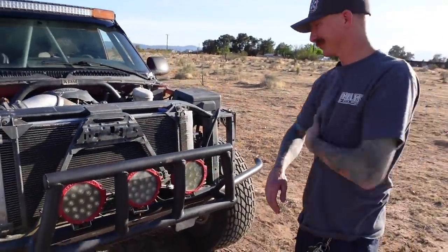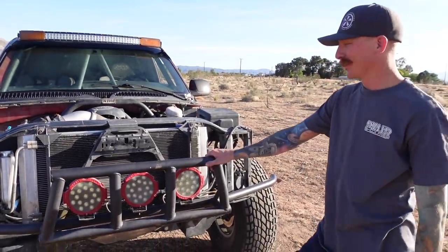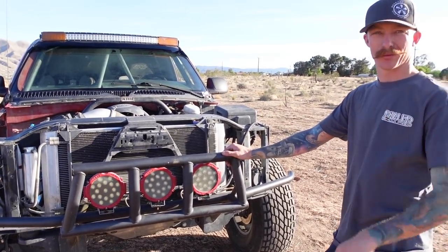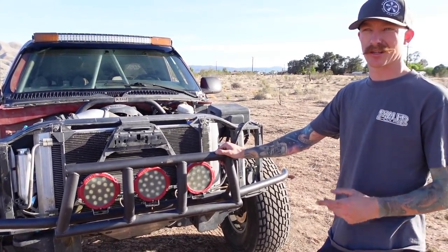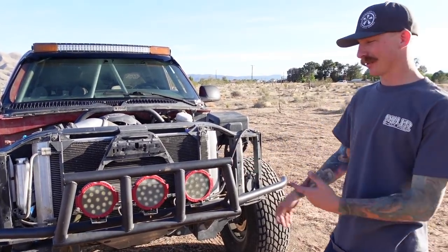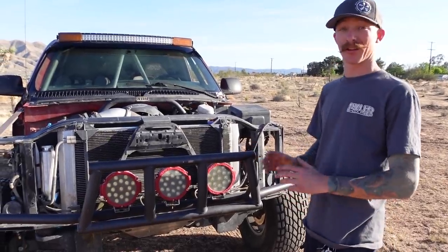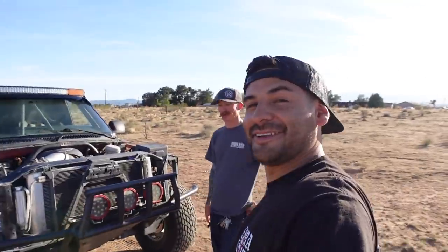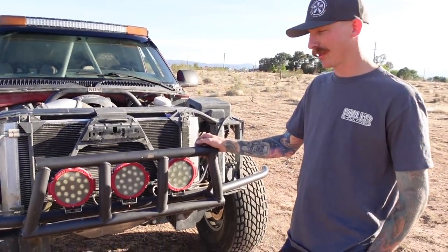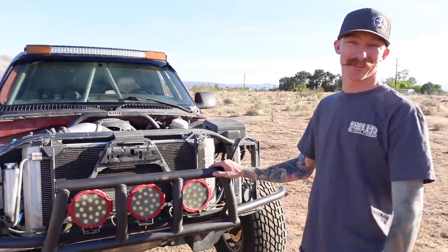I mean, that's what they say, right? The Achilles heel of this thing is the stock steering rack. A lot of the guys that have the Chevys know when you're going out here through the big whoops, they break. I've broken 2 or 3 racks. I broke one the first trip. Put in a TE Designs rack saver, and I haven't broken a rack since. Dang, you guys hear that? Knock on wood, but we'll find some wood to knock on. With the rack saver on it, I did 80 through Barstow Main, and it's still the same rack. It helps.